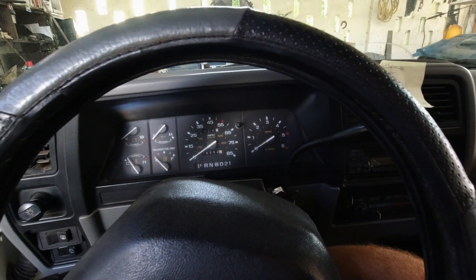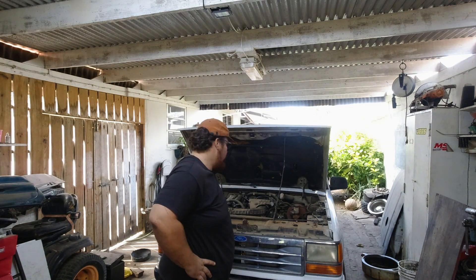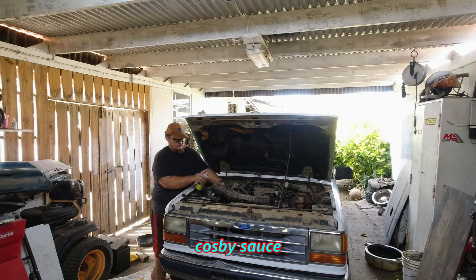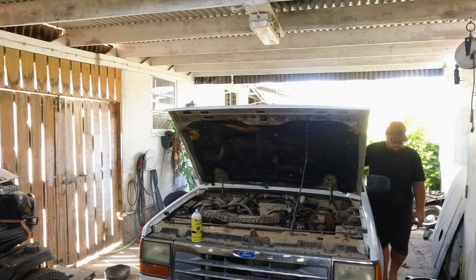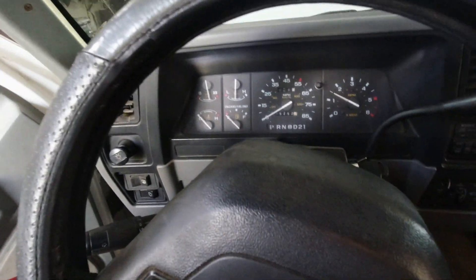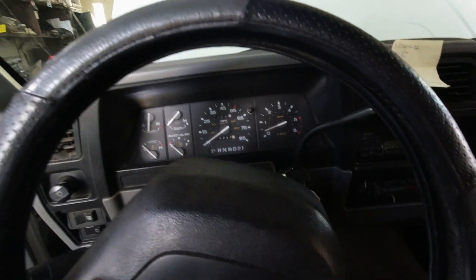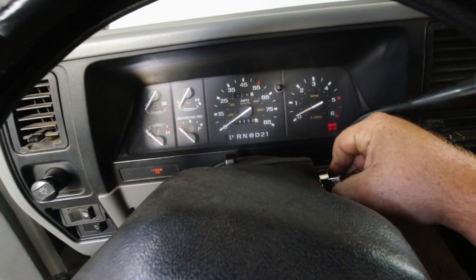Let's go — and the battery is not happy. Okay boys, it actually doesn't look that bad. It's all original. There it goes — oh it's really hesitant. Yeah, you give it throttle and it has a delay. It cut off. Yeah, we have a fuel delivery issue — clogged or something.